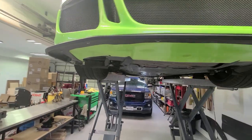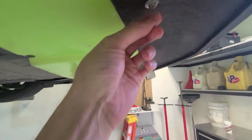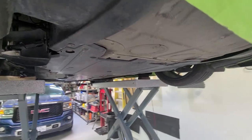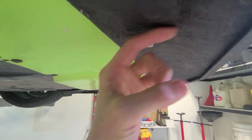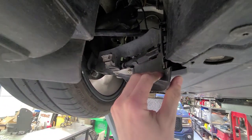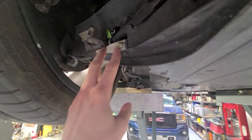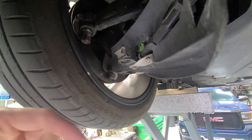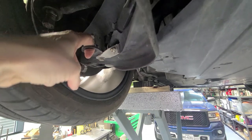With the car up on the lift: you can see the splitter mounting holes and the back piece that bolts with spacers to extend the floor forward, making a nice flat floor at the front. All the factory plastic fits on the bottom — good for aerodynamics. This is a factory GT3-style plastic lip with a fiberglass reinforcement bolted behind it to stiffen everything up. The factory brake air deflectors are on here too — they actually work awesome, even better than most enthusiast-designed brake ducting — so don't rip those off your car. I've also added tow hooks here for loading the car on a trailer, with a matching pair on the back. Makes loading extremely quick without running straps through the wheels or risking damage.